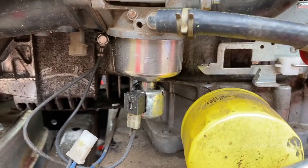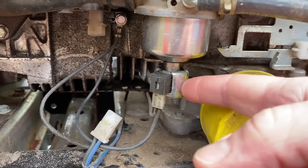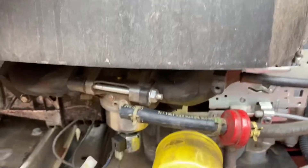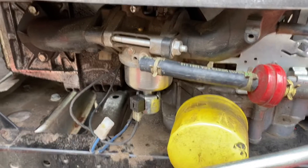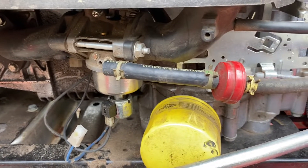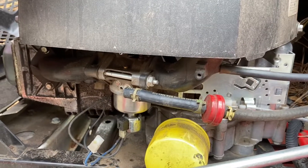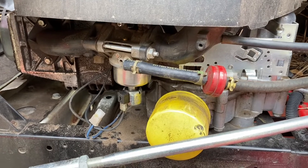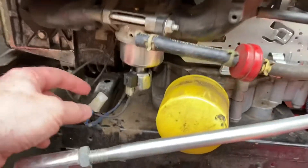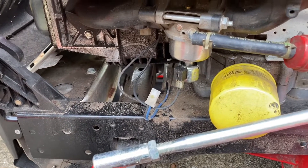I took off the bowl and the little switch here, and nothing. As I said, I blew out the air filter and got it to crank and fire with starting fluid. I've already verified it sparks — we know it gets air. These are simple motors, no electronics other than a couple of sensors and switches, so it should be a fairly simple air-fuel-spark diagnosis. Interestingly, when I disconnected this connector right here, it just started running immediately.